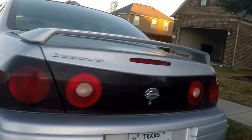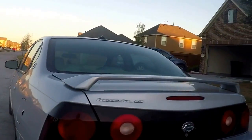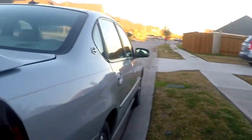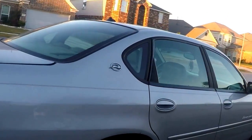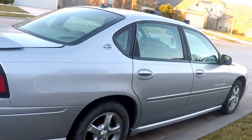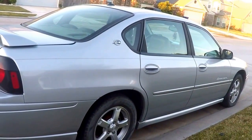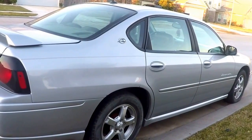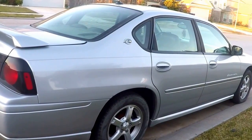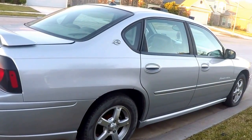We're going to do a quick video on a 2004 Chevy Impala — apologies in advance for the noise. This car popped a P0455 code, which is an evap system large leak. There are a number of things to look at for large leaks; a gas cap can be an issue — generally for large leaks the gas cap is missing or wasn't screwed on tight at all — but that's potentially not one of the known fail points on these cars.